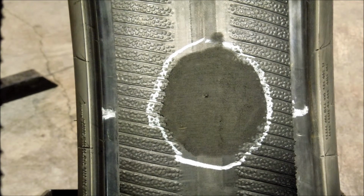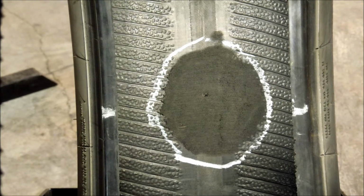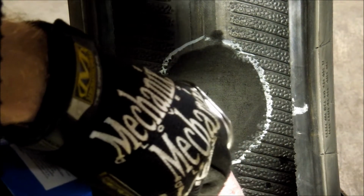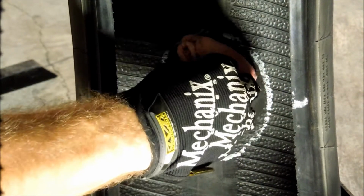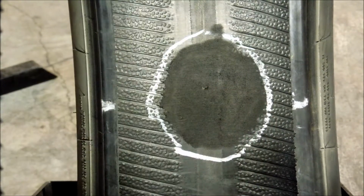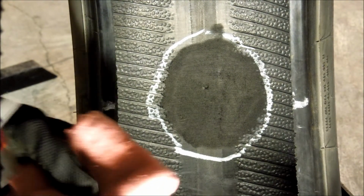After the excess debris has been removed, clean the entire prepared surface with rubber cleaner solution by applying it on a clean, non-treated, lint-free cloth. Do not apply directly to the tire. Allow the cloth to absorb the solution and apply the cloth using a patting method so the rubber doesn't absorb the solution, yet the contamination is removed by the dampened cloth. Allow the surface to dry of the rubber cleaner.